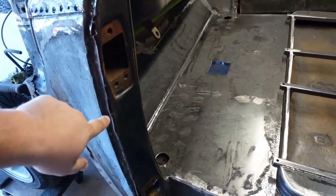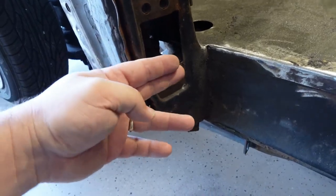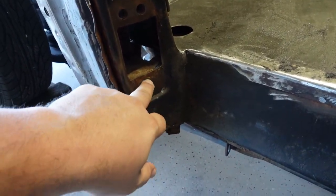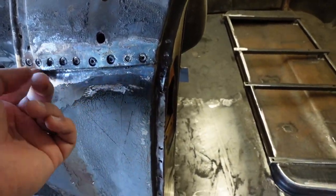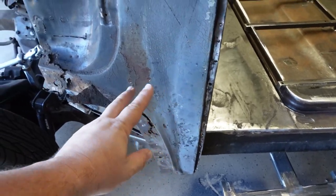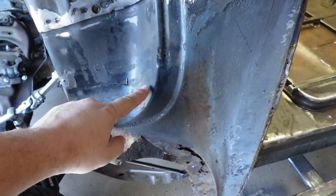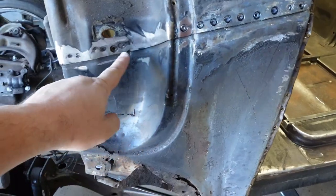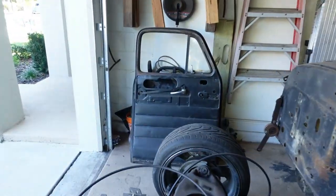I tried to pound on it which just ended up bending it worse, so we just need to straighten this inner bracket a little bit. We used a torch up here and melted out all the lead to reveal the spot welds and got those all popped out. The worst part of this panel is the crease right down along here, which is why we're replacing it. Up in this section we want everything to line up perfectly — we might just cut right across here and splice it in at the seam, since everything down here is rotted a little bit. The door's off and sitting over here — it came off real easy.